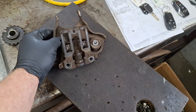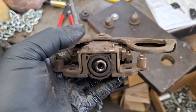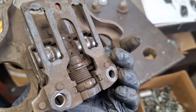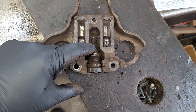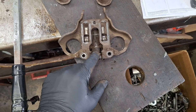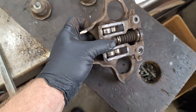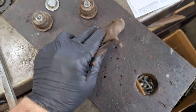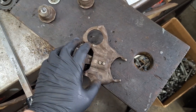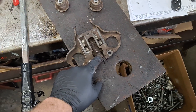Here's a clutch fork out of the car — not the one I'm looking at right now, just an extra one I have. When you turn that clockwise in the release position, it should not move because you would be pulling this inner part here. When you turn it clockwise, it'll pull this inner part and it's at its stop — it should not go anymore. Since it is going more, that means something's damaged inside. When you turn it counterclockwise, it's pushing it outwards. There's a kind of angle in there: when it's pushed inward, it raises this up to apply the clutch. This is matched with a slave cylinder right here — it pushes the clutch and applies it. Since it's turning past the fully released position, it's damaged in there, and that's what's causing the code.